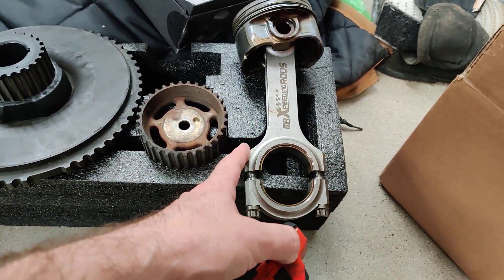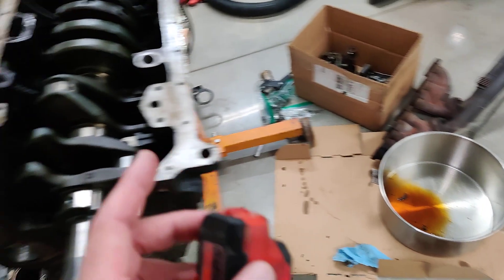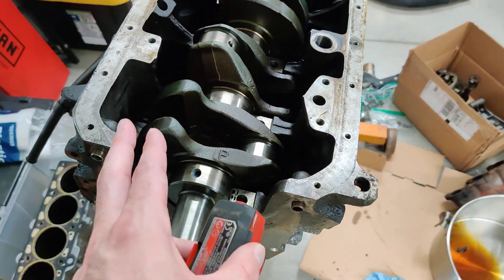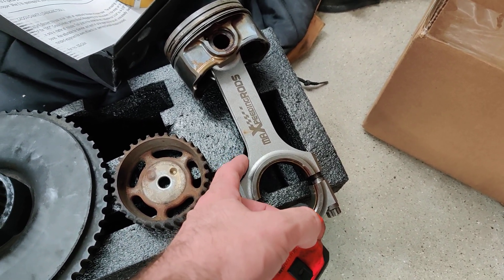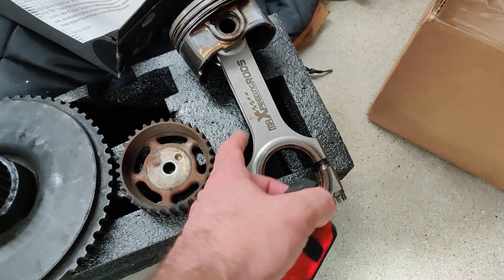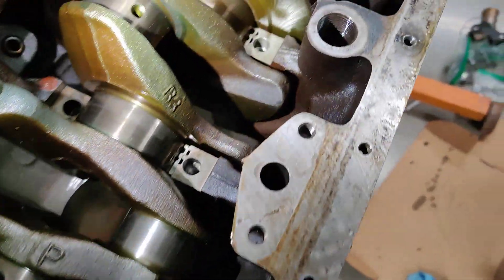The way you can check this — which is what I did — is just take some clay or putty. I used Play-Doh and packed it right here. Then take the crank, put the rod in, clamped it down, and spun it over. You can see the dent right here where the putty is hitting the edge of that cylinder. In this case it had a couple millimeters — I think it was like two or three millimeters on each side — so it was good enough. But you want to watch that, just depending on what rod you use, it can be an issue.